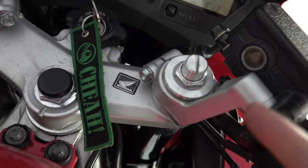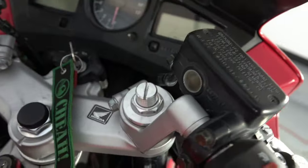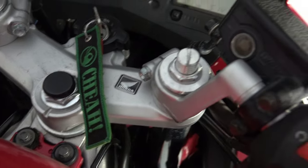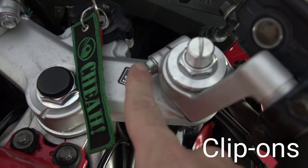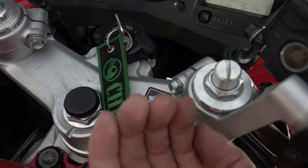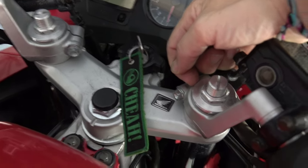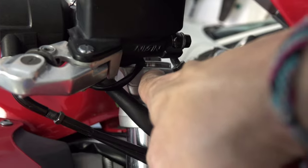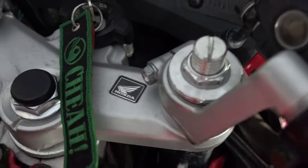You'll need a 12 millimeter — loosen this bolt here, then come this way and loosen this one, and then there's also the bolt underneath at the front bottom triple tree you need to undo to allow the forks to go through. My trick is to loosen the top one but control how much the forks raise by undoing the bottom one little by little. I measure from this point on the fork — I just want to show 10 millimeters from there, and when you hit 10 millimeters, you know you've matched the rear.